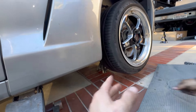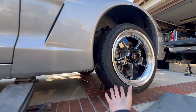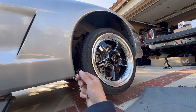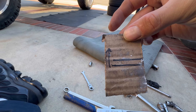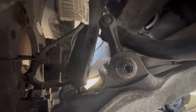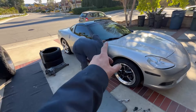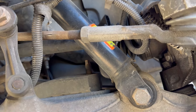For the rear just get behind the wheel - you don't even have to take it off. Put a jack under the leaf spring, then once you put the car down that'll have it loose enough to where you can tighten the bolt with your fingers to a certain point, then just get a wrench to tighten it a little more. We marked our quarter inch right there - place it on and you'll be able to see where you need to be. Front is done and good to go. Now on to the back.